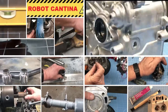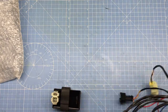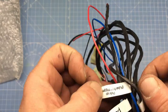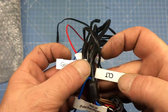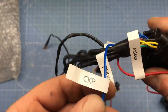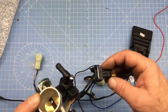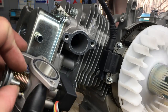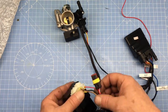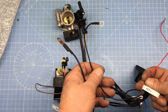In our quest to go faster, we're going to apply some modern technology to the cement mixer engine we're currently using on our street legal go-kart. Today we're doing a technical video — specifically we're going to bench test the small engine fuel injection kit that we unboxed in the last video. We took a quick look at the EFI kit for our 420cc engine, and the kit is close to being complete, requiring only a few additional electrical connections to operate on the bench.